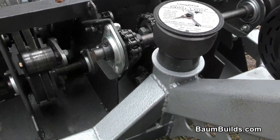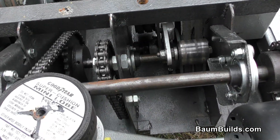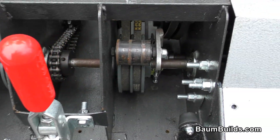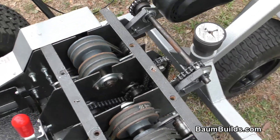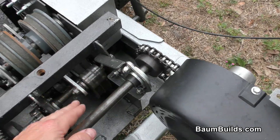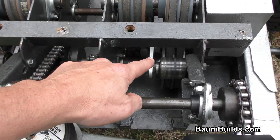I'm just going to do a little drive-by here so you can get a look in there. Let's run through it without the engine on. We have the engine CVT which turns this sprocket, which turns this jack shaft here. From this engine CVT jack shaft we go down to the primary jack shaft which runs the entire length.